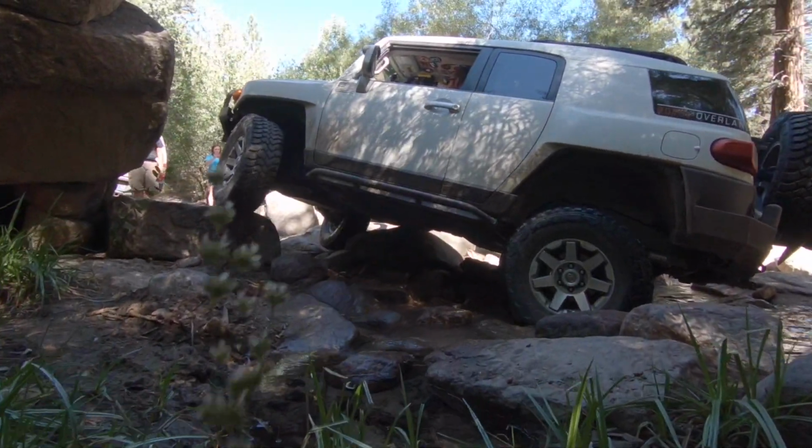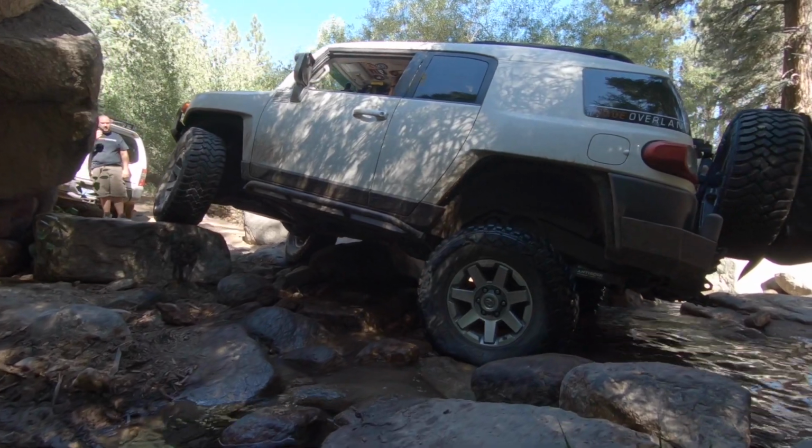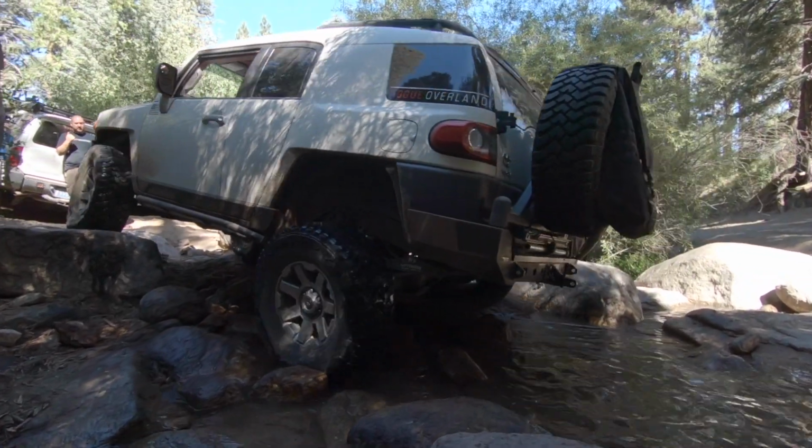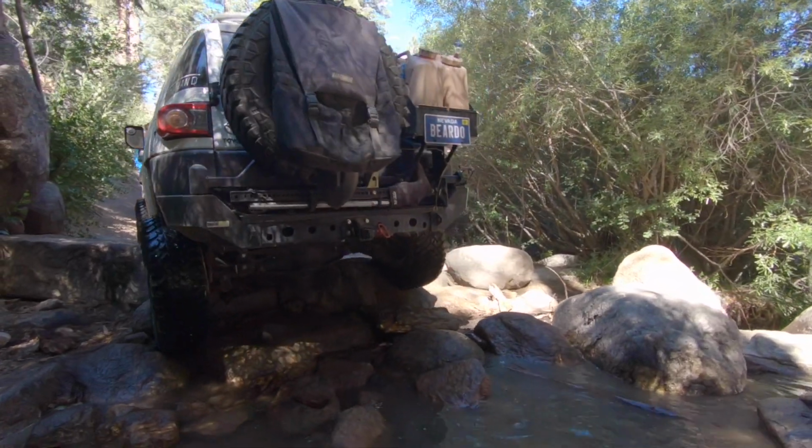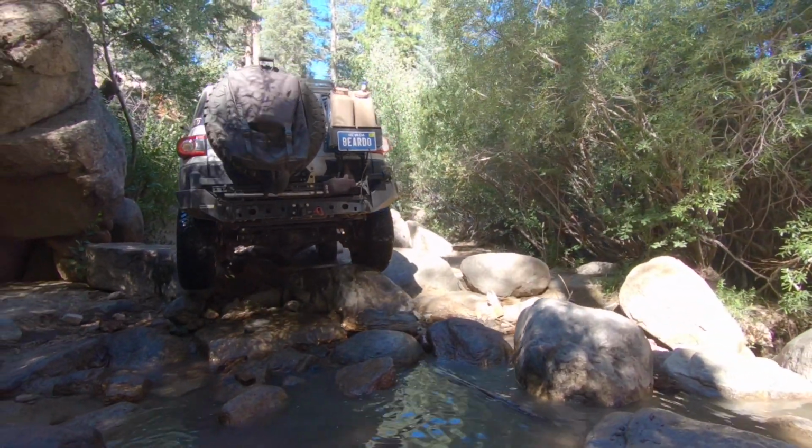Now, you've done a lot of shock tuning on these guys too, right? Extensively. They're not off the shelf. I'd have to pull the numbers from a spreadsheet somewhere. Ultimately, they have about 60% more rebound than what they come with from the factory. That helps with the heavy truck not pogoing very much. And there's probably about 30 to 35% more compression in there to help slow it down.